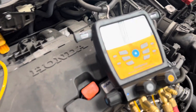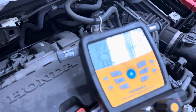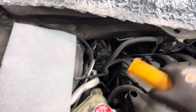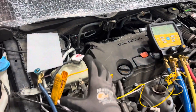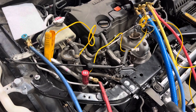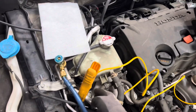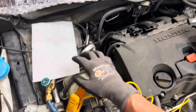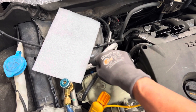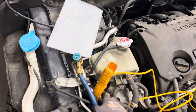Reading 51 degrees — the compressor has just changed again on its displacement — now 54, coming back over here, 57. So you can see there are several degrees difference. On some vehicles when it's really hot outside, and depending on how much subcooling the condenser does, you might see a 10 or 15 degree change — on the extreme side — in the temperature of your suction line going through the internal heat exchanger.